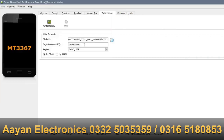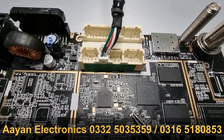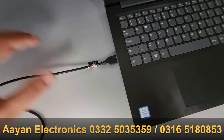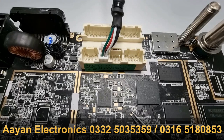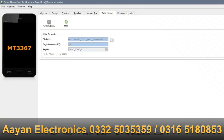Insert the correct details for the address and make sure the right memory block is chosen, then click Write. Push down the test points, and while keeping them down insert the USB cable. Keep holding your tweezers on those test pads until the boot1 upload is completed. Once successfully completed, you no longer need the test point method to install new firmware or import your user ROM file.